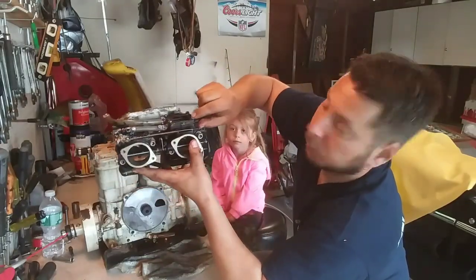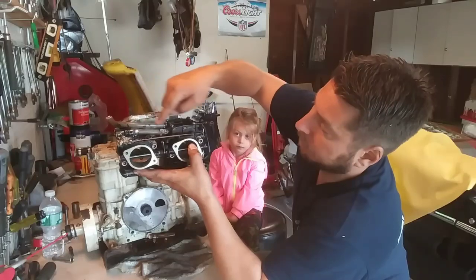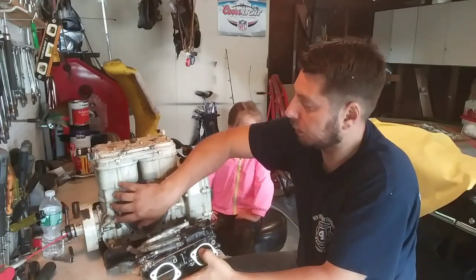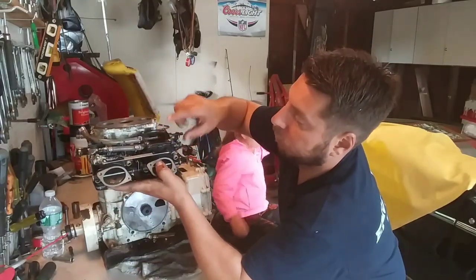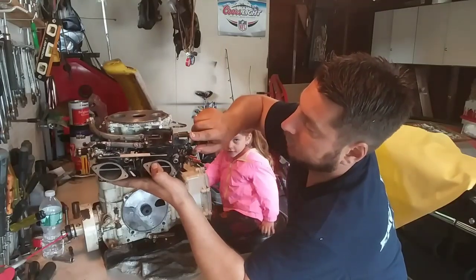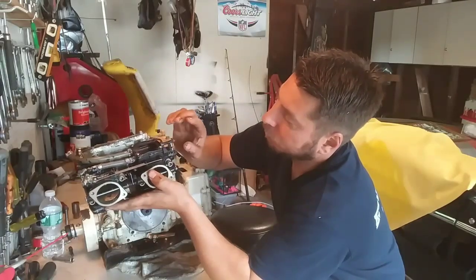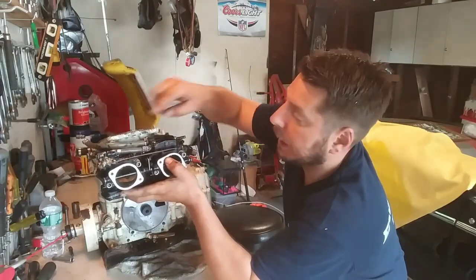See how this block is a little bit taller than this one? This one here is the actual pump. It's a little diaphragm that goes up and down, pulling fuel in and then pushing it into both carburetors. When this is connected, it connects onto this port right here, which is the underneath of the piston in the crankcase. As the piston goes up and down, it creates a pulsating positive and negative pressure. That transmits to here, where this diaphragm is going to go up and down and pull the fuel. So on this port, it gets connected here — this is the backside of the diaphragm, creating a negative and positive environment, fluctuating up and down and pulling the fuel in.